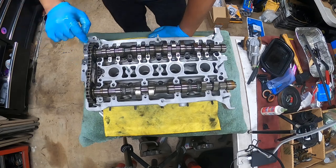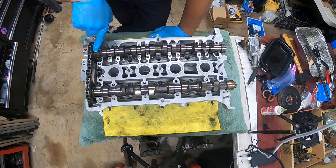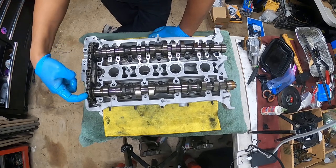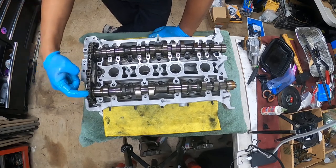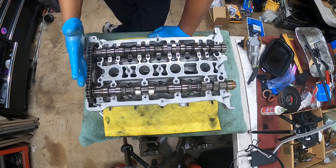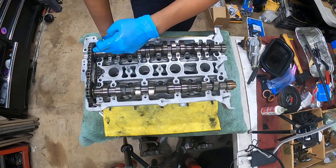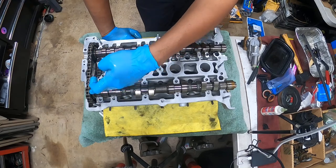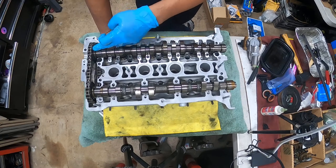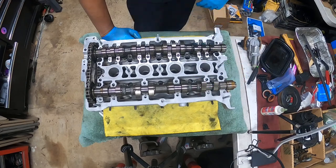Now, this one sits directly underneath the notch. That one actually lines up. This one over here is left. Okay, guys? It's super important you understand that prior to doing any other work. A lot of people think it's just 16 from here to here, and it's not. It's always one over and then 16 and one in the middle. It's how the Bentley manual states it. It's how it's done, period. Okay? Next step.